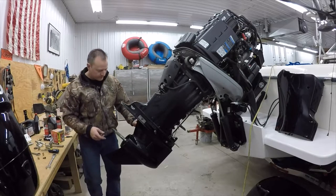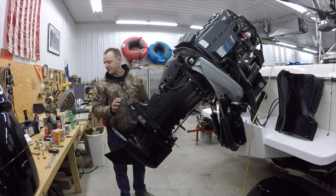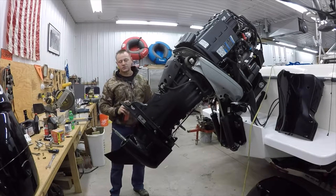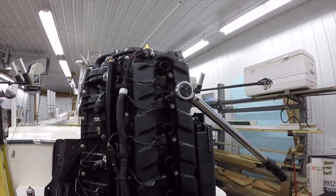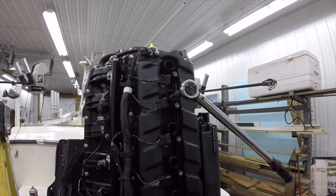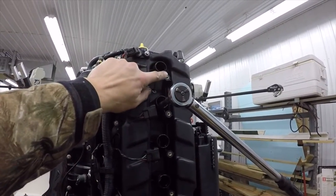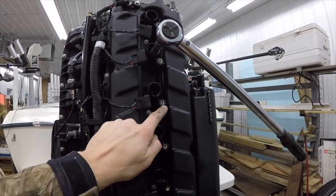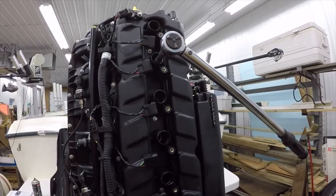Lower unit is completely drained. Now we're gonna work on the spark plugs and putting in the storage seal — I'm going to spray a little shot of this in each cylinder. When reinstalling the spark plugs or putting new ones in, I put some anti-seize compound on the threads. Make sure you don't get any on the tip of the actual spark plug — keep that area clean. Torque to 20 foot-pounds. Then we will place the pencil coils back on, and those get 71 inch-pounds of torque. You don't want to over-tighten these — there is a threaded insert that's injection-molded into the plastic, and if you over-tighten it, it's possible you could break it. So pay attention to your manual.